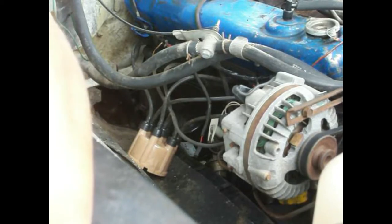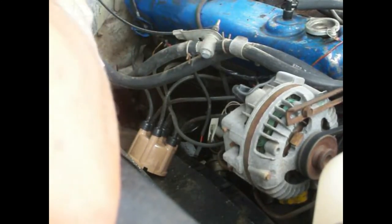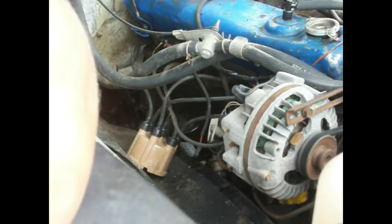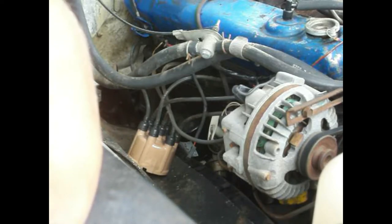It's missing a little bit — it won't idle. I know I've got a vacuum line up here that's bad, so I'm going to try to cut that off and temporarily get it fed up on that carburetor. And then I've already popped the cap off, and we're going to pull the rotor out and look at the points. See how they are. I need to get them gapped and cleaned up. I've got an old-fashioned points file in there I think I haven't used in 40 years, so I'm going to get that out and give it a shot.